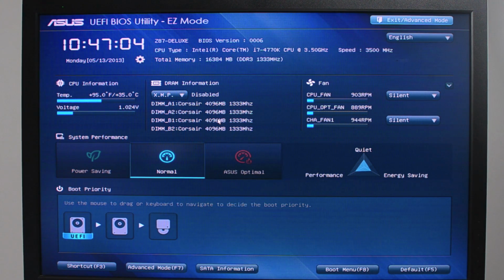Now for people who don't know, SPD is just the serial presence detect. It's a little bit of programmable memory on your DRAM stick that has all of its timing information built in. Correct. And then XMP is kind of like an overclocking profile on top of that. Correct, yes. And the majority of kits that are purchased for the enthusiast oriented platform, and even for moderate or standard builds, tend to be XMP enabled memory.